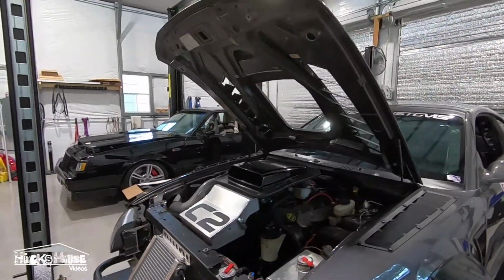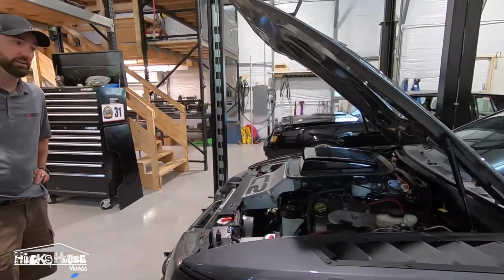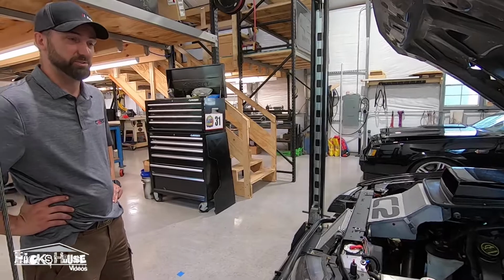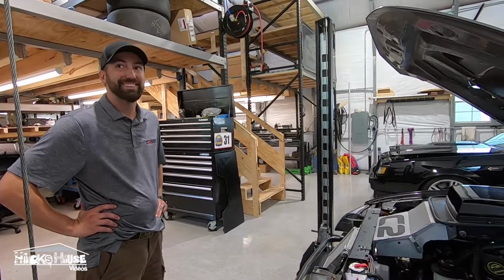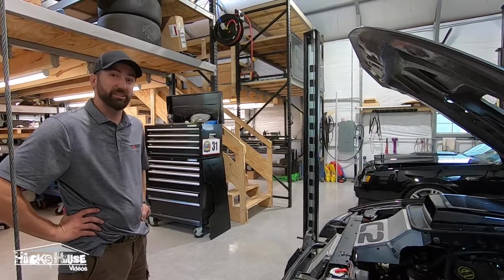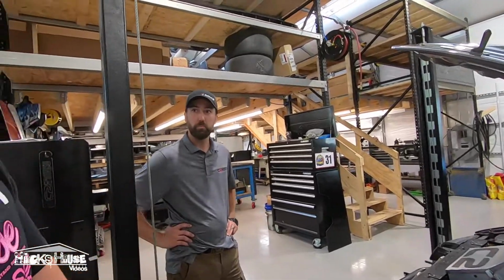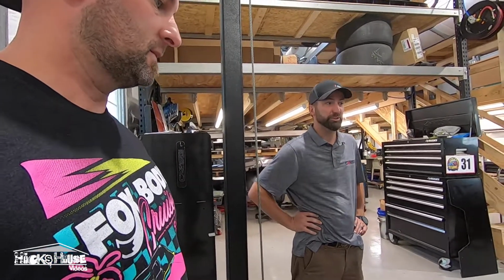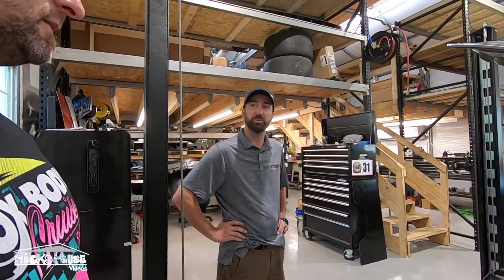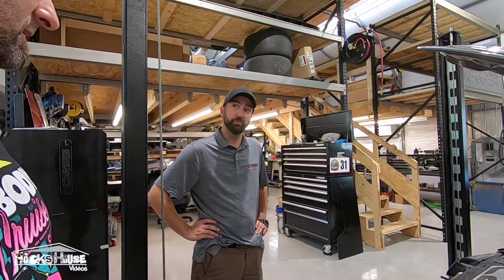Yeah. So what transmission do you have? T56 Magnum. Okay. Topped with an S1 sequential shifter on it. Do you like it or not? I love it. It's a lot of fun. Yeah. And I never cared for the way the Magnum shifted. I tried a couple different shifters on it. The gates were always pretty vague, and I had a couple misshifts at wide open throttle on the road course, and decided that that shifter was a whole lot cheaper than a new motor.